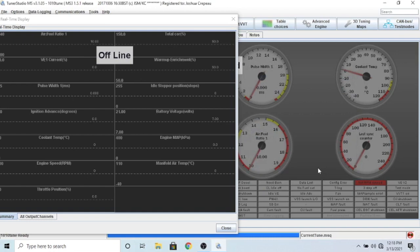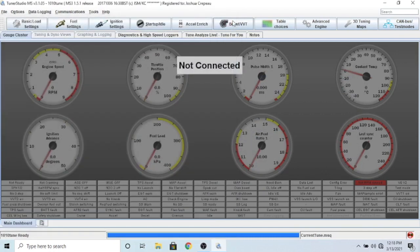I would burn that menu again because it's an important one. When you click burn it saves everything you've done - so if you changed the fuel table but didn't want to save it but then burned it later, you just saved that fuel table. Always remember: anything you burn saves everything you're currently set up with in TunerStudio.